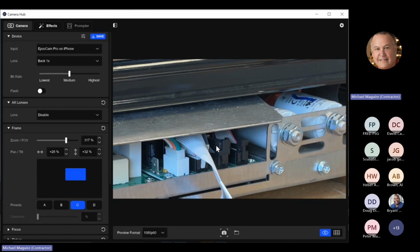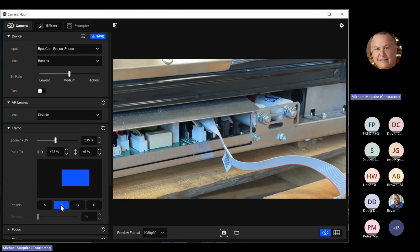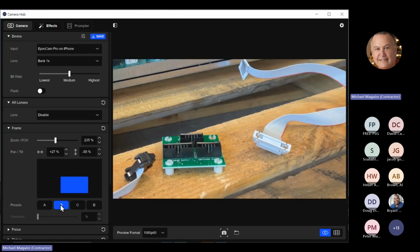On the 7 series, if you take your kick plate off and your grill over to the right side, you're going to see a ribbon that they've supplied that comes out from the back. So you don't have to pull a range to plug in the 7 series. There's already a cable there. This right here and this terminal here, these are part of the range. One is for the right oven, one's for the left oven. And this third connector here is normally vacant. There's nothing plugged in. But you plug this cable in to do the clock kit.